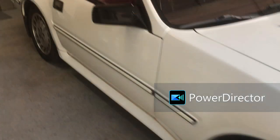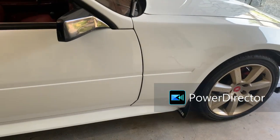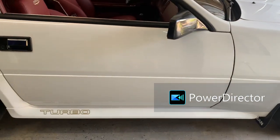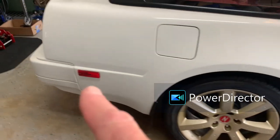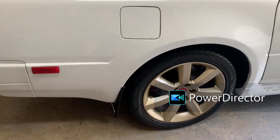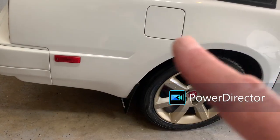We picked up some nice center caps for them. All the side moldings have been deleted. They're all self-adhesive, and you can get some strong waxy nylon string behind them like dental floss with some heat and they come off. Same with the back here. The only thing you'll find is there are two holes in the back that aren't used for any North American trim, but I believe might be used for trim in Japan - those had to be welded up and then painted and blended in.